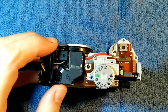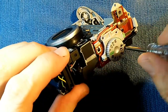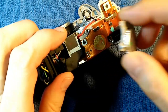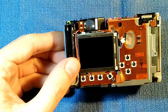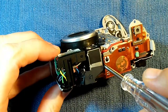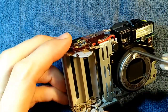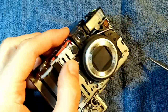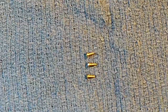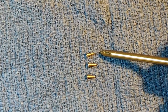We will remove the control wheel from the top — it's held on with two screws. Those are both two-millimeter fine thread screws. And off comes the control wheel. Next, we will remove the viewfinder, which is held on with three screws: two on the top and one on the front. These three screws are narrower than the others — they have a shaft diameter of only one millimeter and are four millimeters long.